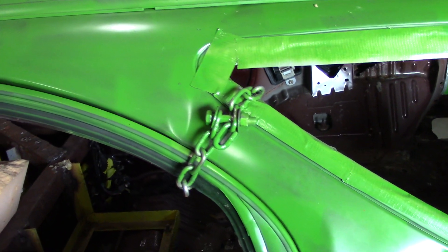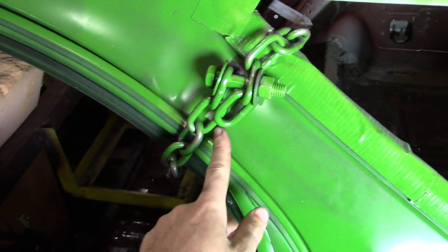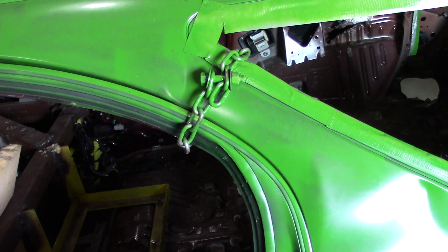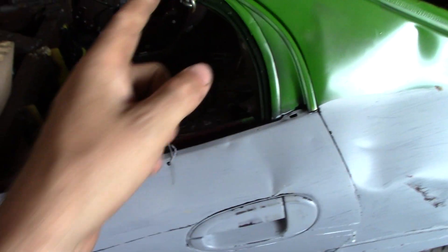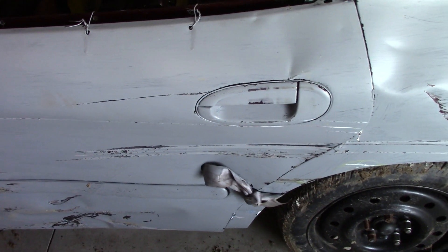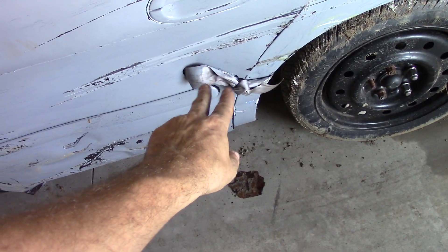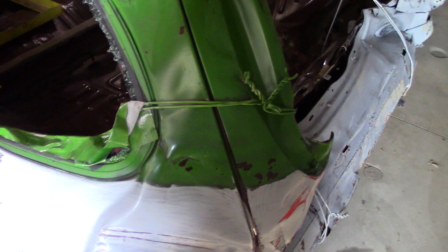You want the chain as tight as possible — I can't even wiggle this one, it's sucked all the way into the metal on both sides, pinching the door in place. After the car's been run, you remove the nut and bolt, the chain is undamaged, and you put it on the next car. In theory, you should get years and years of use from it, making it much cheaper than buying nine wire for every car. I don't use chain low on doors because you'd need a bigger hole that makes doors tear more easily. I also won't use chain anywhere the car could smash around it and trap it — like the back pillar or trunk lids.